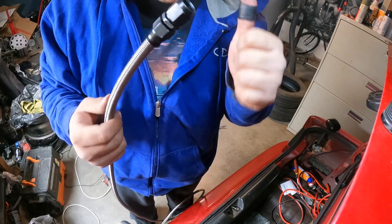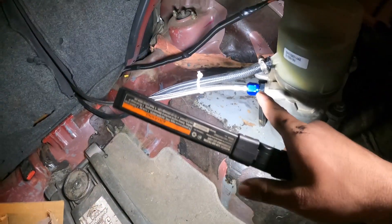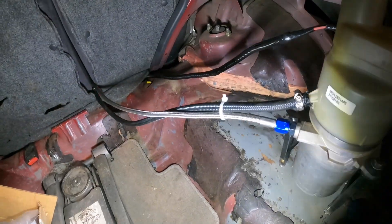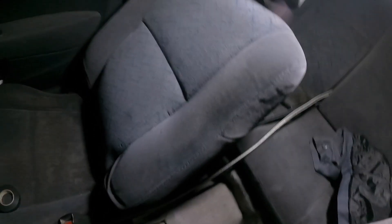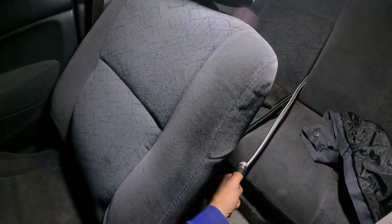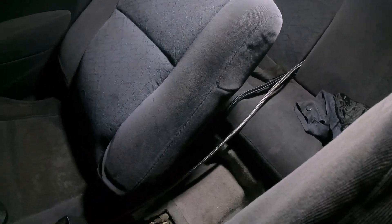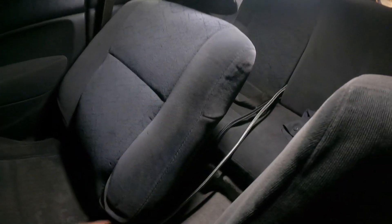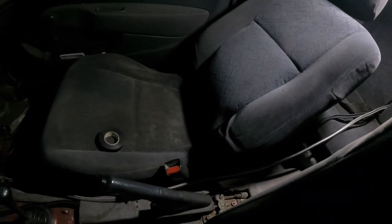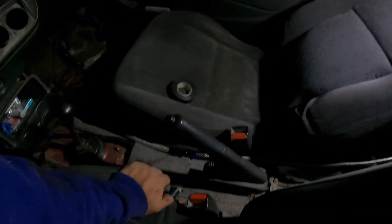Hopefully it doesn't burst - praying. I have the new hose already on, just snugged it up because I'm not too sure exactly how tight it's supposed to be. I haven't ran it to the front yet. It's gonna be like this for a little while - ran inside the car because I don't want any harsh kinks in it. This is pretty free-flowing but eventually I'll make it cleaner, because I also want to run my return and high-pressure fuel lines when I put in a fuel cell. I really don't want the hose ran under the car.